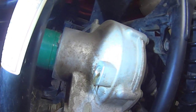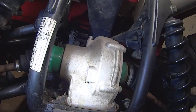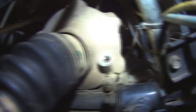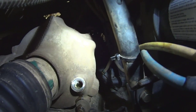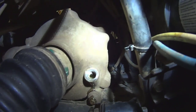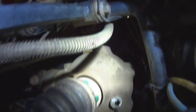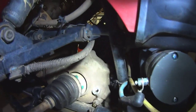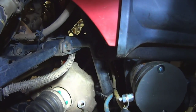That's the rear differential — I just topped it off, making sure it's spilling over, which is when you know it's level. This is the front differential — again I topped it off till it's spilling over. I put a few drops in there; it was pretty much already at level. Maybe an eighth of an ounce, not even — just a few drops. All the seals are good, nothing's leaking. That's the last step — I just checked the front and rear differential fluid.